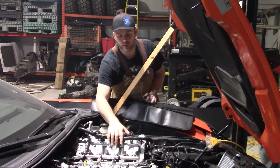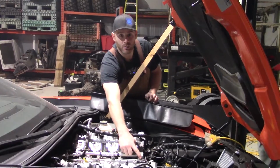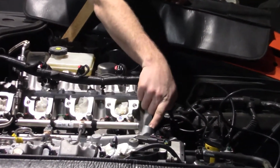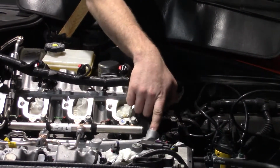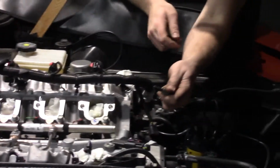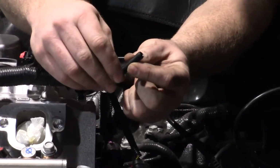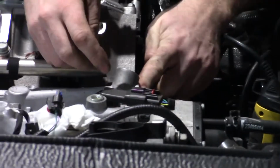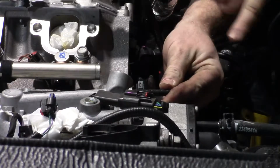Now that we have the valve covers modified, we're going to go ahead and modify this PCV right here. So you remember earlier in the video, we took the PCV out of here when we had the intake manifold still on. It was the 24mm socket. So that threads out of this hole here. They give you this little tool, which is a threaded rod. Maybe some of them are a bolt or whatever. So there's a little spacer in the end of this that's not threaded currently. We're going to jam this thing in this way.